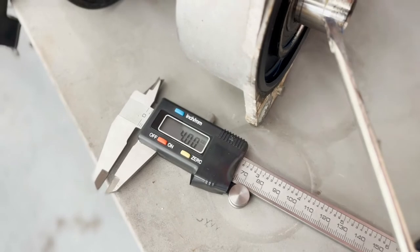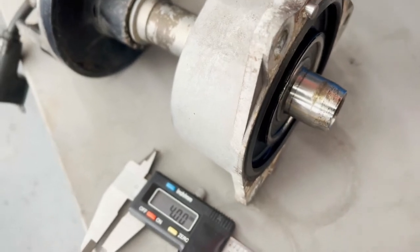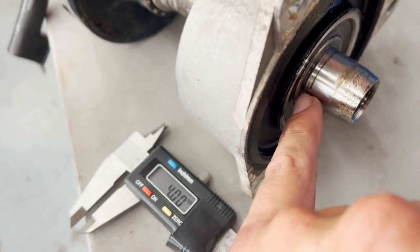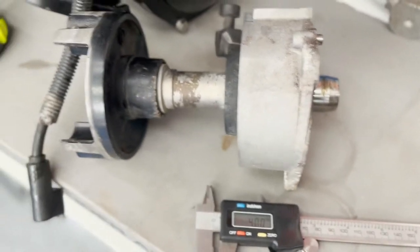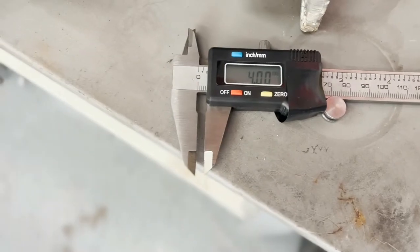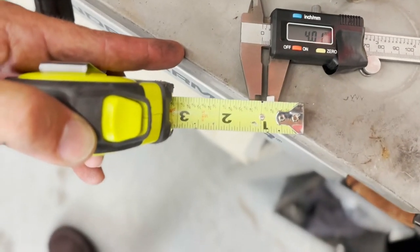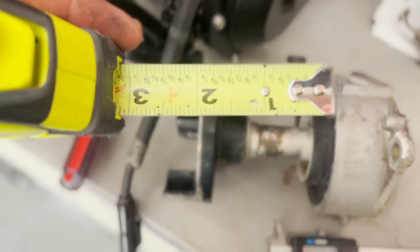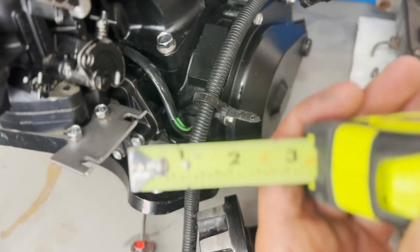Here's my mid shaft assembly. You can actually see a little ring mark on the shaft — at some point this thing has been pushed back, right where it rides on the bearing. I'm going to push the whole thing forward. The recommended gap between the couplers is 2 to 4 millimeters. Four millimeters is just over an eighth of an inch. The gap I had was about three-eighths of an inch — that's a pretty big gap.